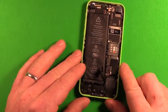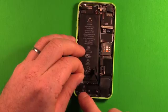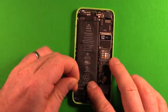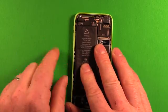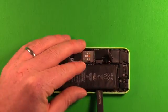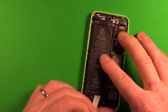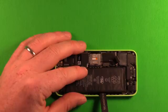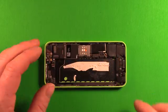Do the left side first — grab the strip with your thumb and finger. Don't pull straight back because of the headphone jack and a sensitive cable in front of it; instead, carefully pull and slip around the corner, pulling all the way up through. The strip can be up to 12 inches long. Apply a little more heat on the backside for the second strip, leverage to wiggle it loose, then pull it out. If the strip tears and doesn't come out completely, keep prying — give it a little more heat if it seems stubborn until it comes right out.